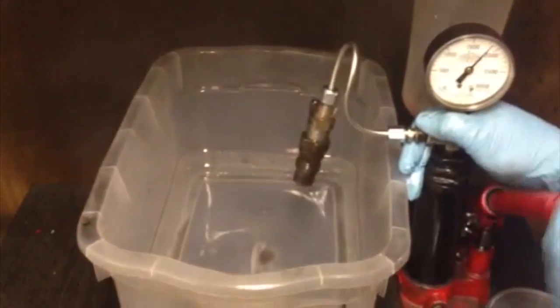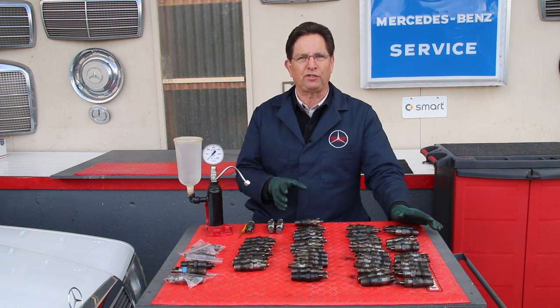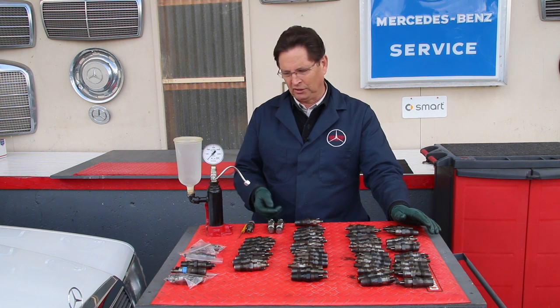Notice the mist here. If it's not picking up any mist, it probably means that the injector is firing too much fuel, and that's going to affect power output as well as fuel economy.